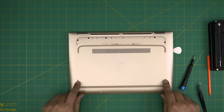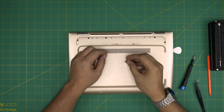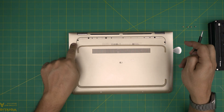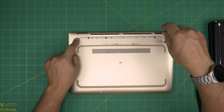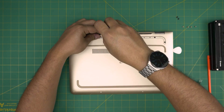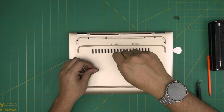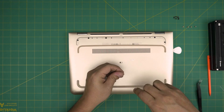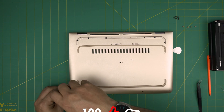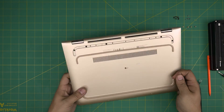There's nothing in the front, only under the rubber strips. Use a needle to remove the plastic cover hiding a screw. Under the back rubber strip are black-headed screws — remove them and keep them in one pile, they are all the same size. The rest of the screws are chrome-headed screws — go ahead and remove all of them, including the one in the middle. If you find my videos helpful, please click like and subscribe.